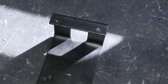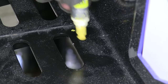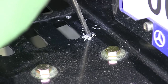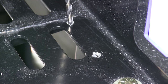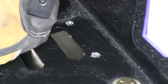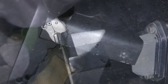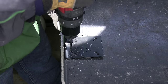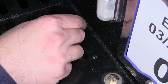First, let's bend our bracket. With our bracket already pre-bent, we'll set it in position and make a couple of marks where we'll need to drill the holes. Once we have the holes drilled out in the bumper, we'll set the bracket back into place and use our drill bit going through the holes we drilled in the step bumper to mark the bracket. Now with the bracket marked, we'll set it on a bench and pre-drill the holes. With all the holes drilled out, we'll set the bracket back in place, drop our hardware in, and tighten it down.